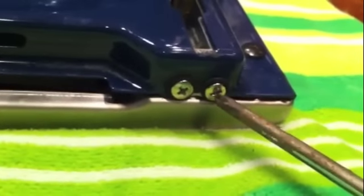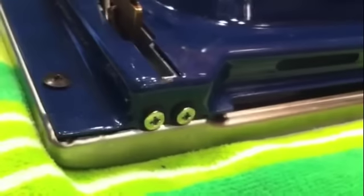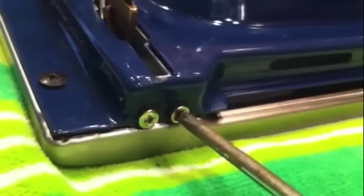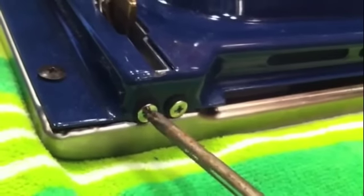In order to separate your door for both hinge removal and door cleaning, you will need to remove the screws along the bottom. This model has four screws going in through the bottom of the oven door — two screws going through the left hinge and two screws going through the right hinge.